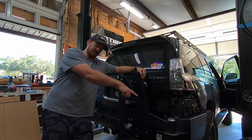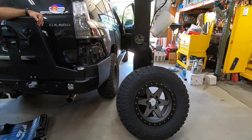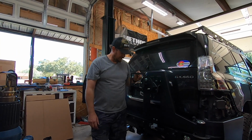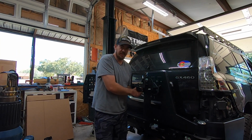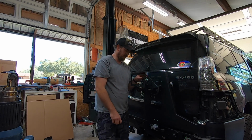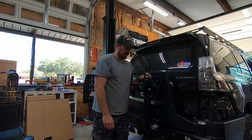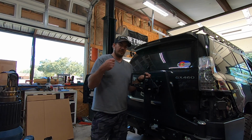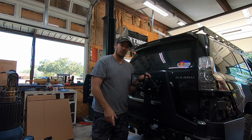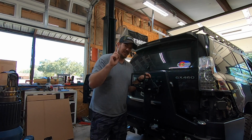Spare tire. You guys can see that spare tire sitting right there? There's a reason it's not on here. I bet you want to know what that is. The reason it's not on here is Victory sends SAE half-inch 20 lug nuts or wheel studs to mount your spare on, which is fine because they also send the accompanying lug nuts. However, these wheels don't allow you to be able to put a socket inside them. You have to have fancy spline nuts, which our customer thought ahead on. And he ordered them in M12 by